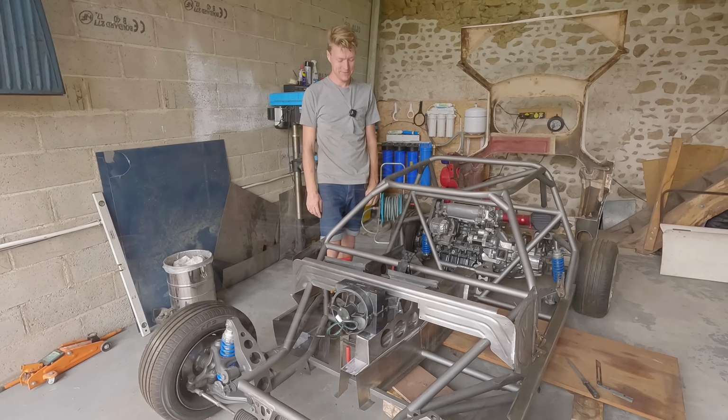Should do that. So we've gone for a big perimeter and a small perimeter rather than the X, in the hope that it won't deform the panel as much as doing a cross. Because when you do a cross, you run across your own bead roll. And we learned that last week. In a small cross, it was all right. But I think in a big long one like this, it'd completely twist the panel. And especially because it's only half mil. Yeah. I think it'd really like...